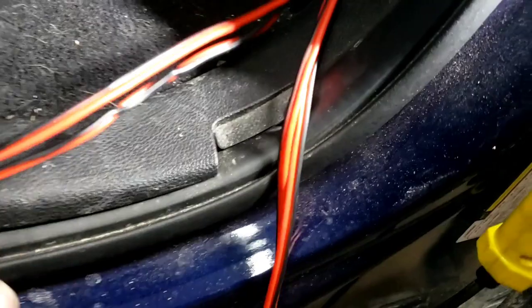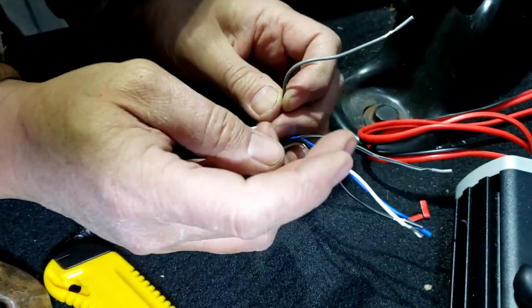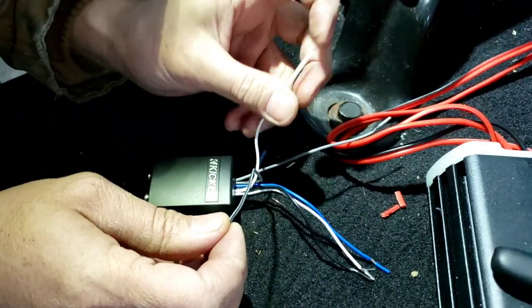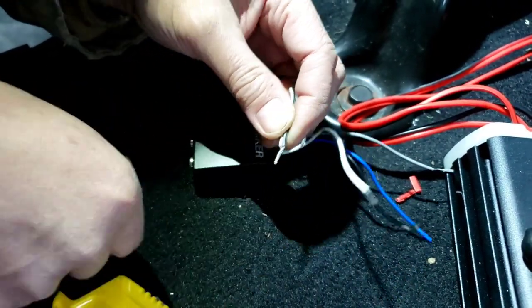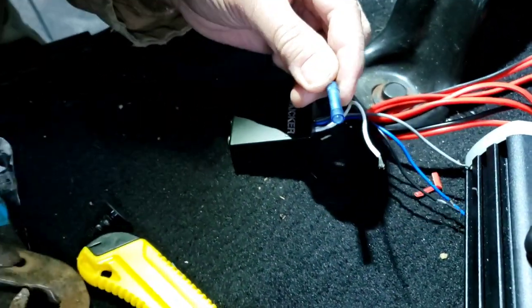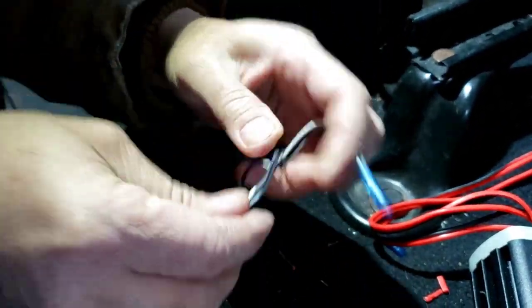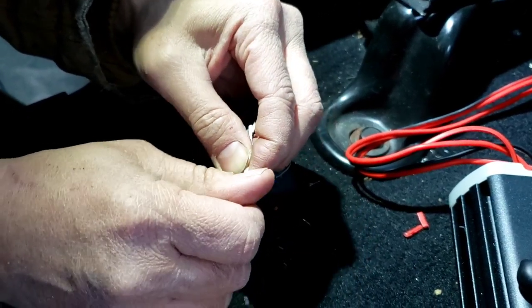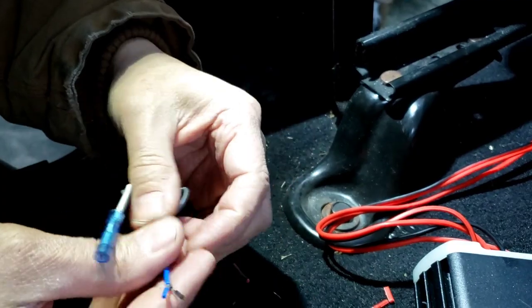I ran the wire to the back — speaker wire to the back — ran two wires so we can run through the speakers over there. We're going to put in the Kicker KISS LOC 2. A lot of people ask me why I bridge the two channels together. The reason is you don't have to do left and right separately — that's just spending more time. So I put gray/black and white/black together on the negative side, and gray and white together on the positive side. Remember, we're not trying to have surround sound — this is the subwoofer. People ask if bridging changes the sound — no, it doesn't. I tried it before and it works very well.